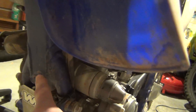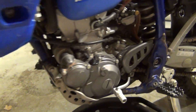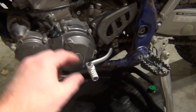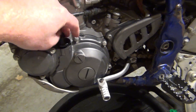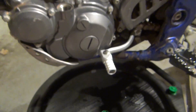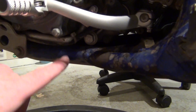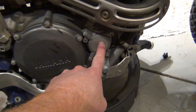If it was warm, you would: A - check the oil from there, B - go down here, undo this bolt, drain the oil out of the frame. But if the bike's been cold and sitting a while, gravity works it all down into the engine. So you've got your fill cap - get this off. It's not a dipstick, it's just a fill cap; has a rubber seal on it. That's where you put the oil in. To take the oil out is this bolt right here, which is a 12 millimeter.